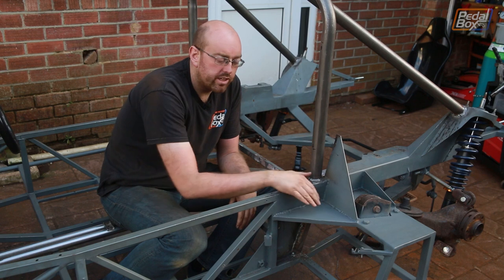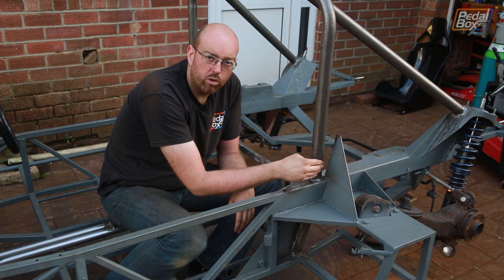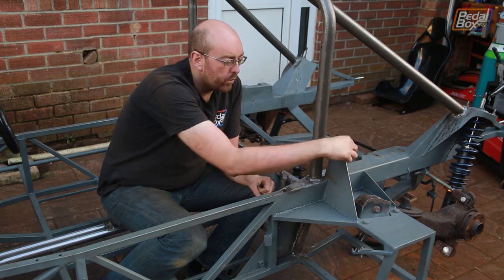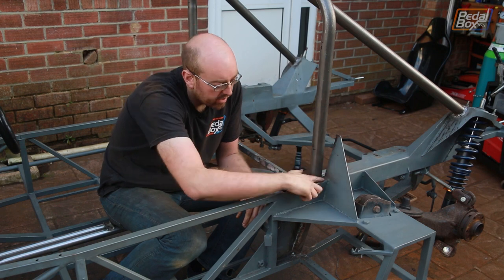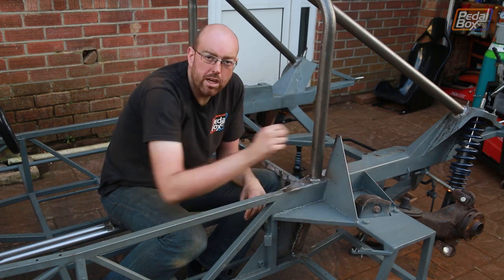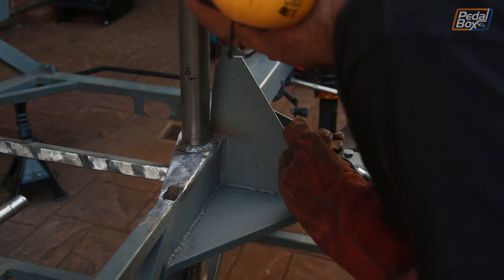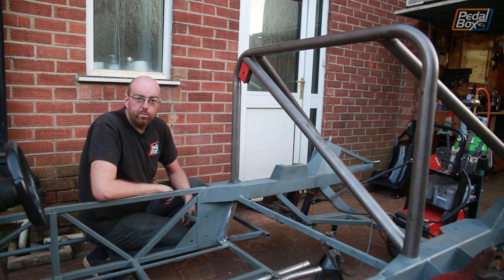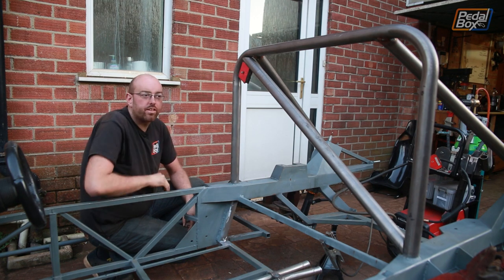There's one glaring thing we obviously need to do on this side, which is cut this down. We were hoping to integrate it into the edge of the roll hoop, but because of where the hoop has ended up — a little bit further forward than originally planned — we're not going to be able to attach it in any sensible way. So we're going to cut this down from the top of the chassis rail out to here, just to match the one at the back. This diagonal piece is the last part we need to put in to support our main hoop — I've got it all sculpted out and magged in place. I'm going to tack one end, make sure the other fits, then tack that end in to match.